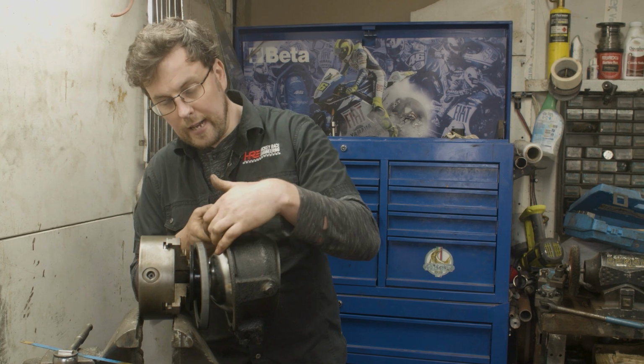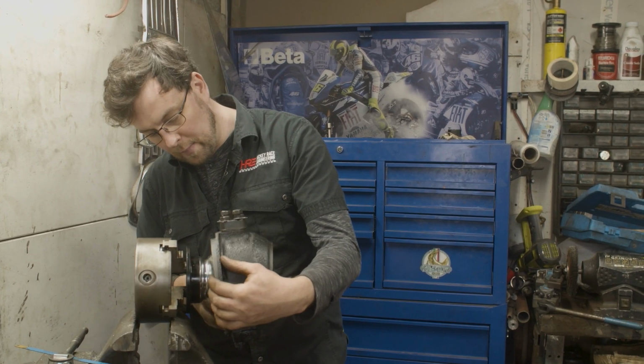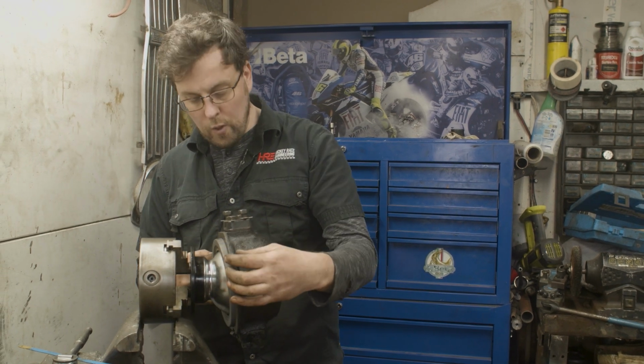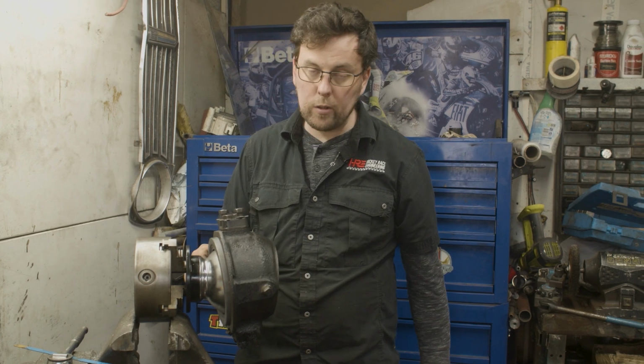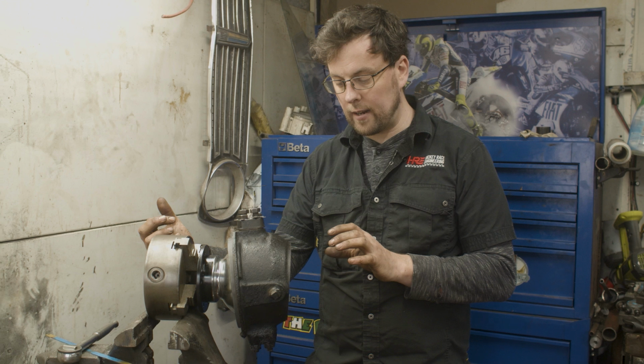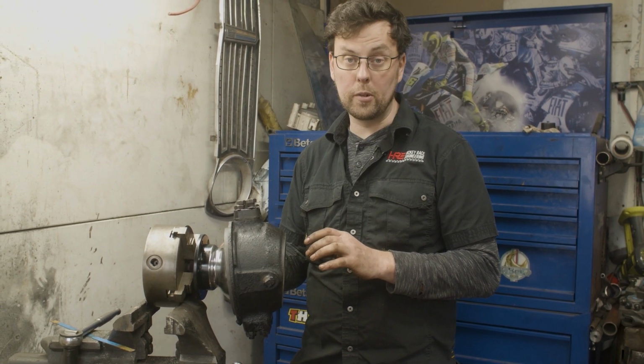So a bit of gasket cement in there helps it seal, and a bit of grease on the wiper then helps the seal centralize. Then it's just 3 bolts. One of those bolts is a bolt for setting the maximum turn that you can get on the swivel hub, I'm going to set that on the car. So for the moment, I'll just put it in there loosely.